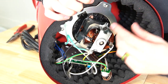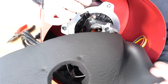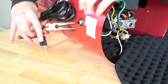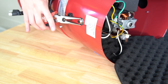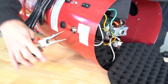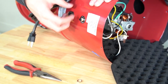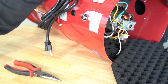Once you've got the wires removed, we need to remove this foam piece. Once you've got the foam out of the way, you're going to need to remove this nut on the circuit breaker reset button. Get a pair of needle-nose pliers and twist that nut off. Same thing with the low voltage connector — go ahead and twist that nut off. Set those two nuts aside so you don't lose them.